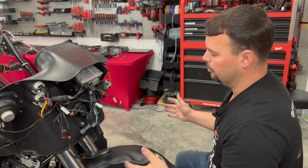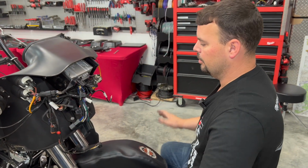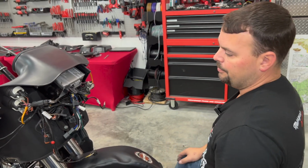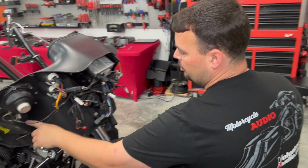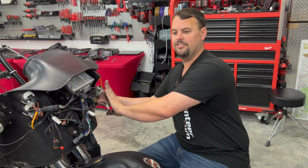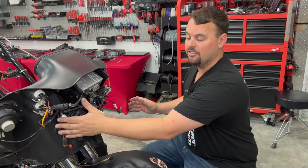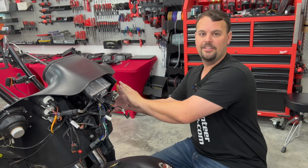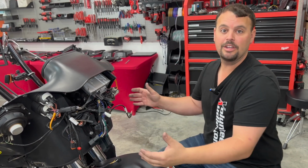We don't want somebody having trouble. We don't want to fight it on, and we don't want to end up with somebody pinching wires in there as well. So we'll get a drill bit. We'll drill on our USB. I'll go ahead and cut and kind of get this moved over. But as you know, on this install, we're also putting an amplifier to mount on this side, and it will actually T-harness into these plugs as well. So we'll keep all of our plugs on this side and our amp on this side, trying to keep this area just kind of free of wiring.